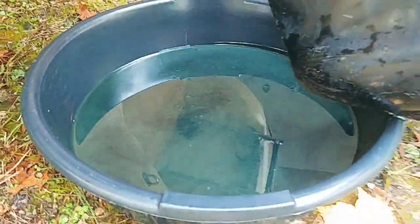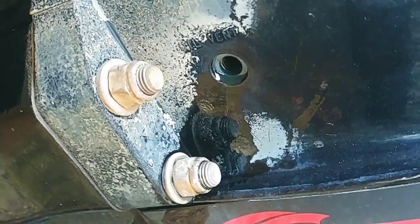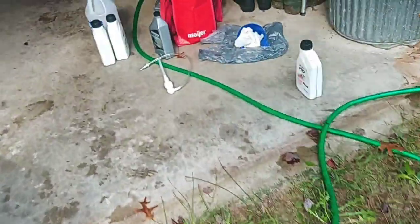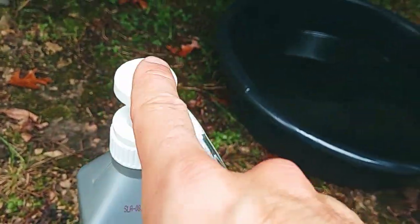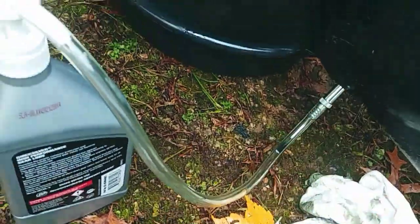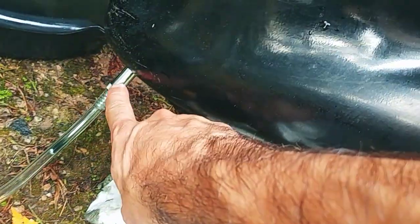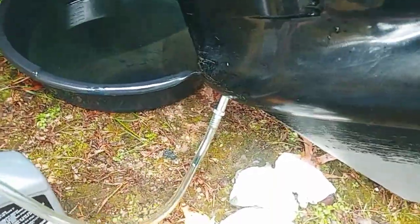This oil looks not great. I'm going to keep the vent cap off and attach the little pump over here, then start pumping oil up until it comes out the vent cap. A couple of things to note: don't put this in the bottle until you have it attached here, because you have to spin this and the whole tube will spin with it — you don't want to keep turning the bottle over and over. So first do this one, attach it hand tight, and then put it in here. Then we're going to pump it until it starts coming out up there.